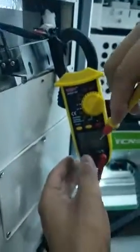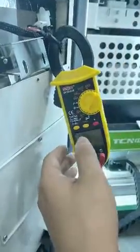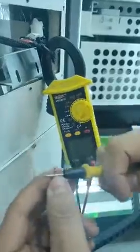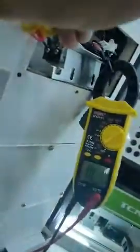You can use the resistance setting here, or this — a better option. We short circuit like this and you will hear the sound. So we test when the micro switch hasn't been pressed. This state is the door opened, because the handle hasn't been pressed. Now we press it. Test again — you hear something like this. So this micro switch is fine.